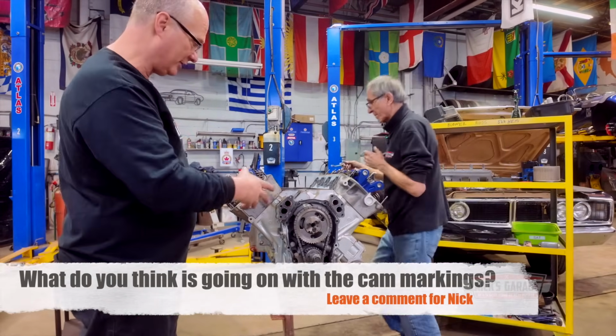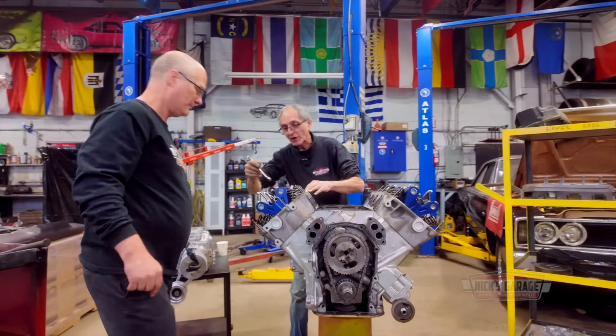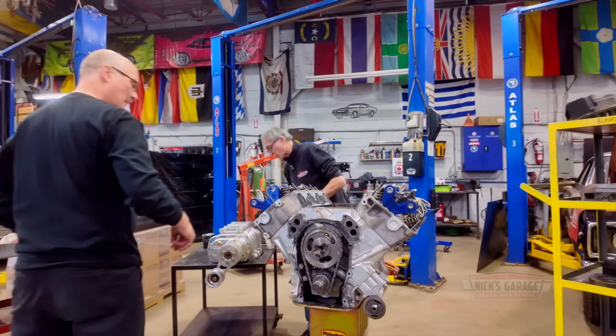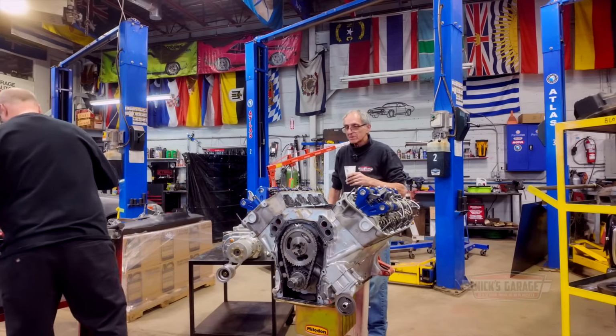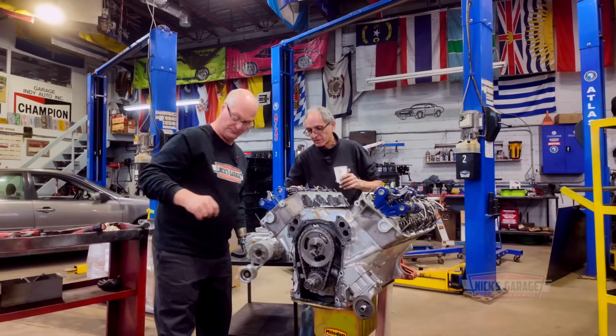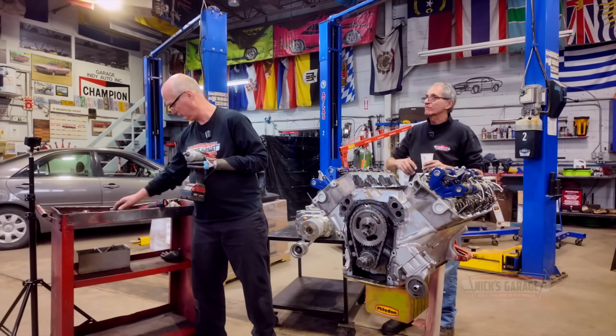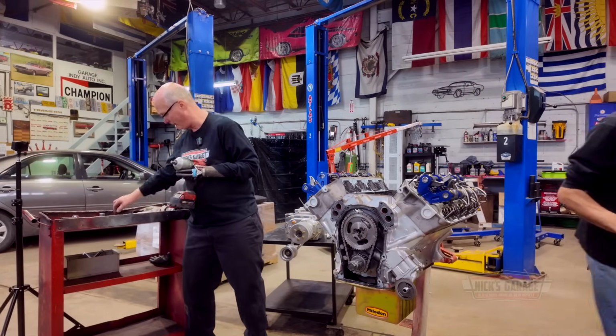What do you think? You want me to take the chain off? No, don't take it off. Okay. Let's take the lifters out. Crack this head loose, okay? Sure. Meanwhile, take up the main. Start with this, okay? You could crack them and start from the ends and go in. Yep. I'll go get a box to put the lifters in. I'll be right back.